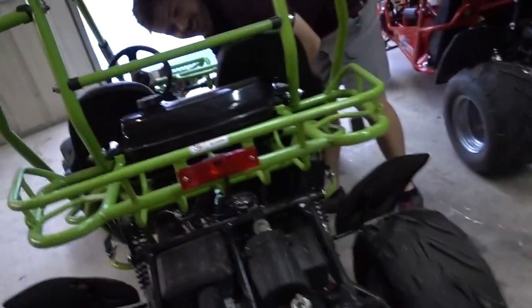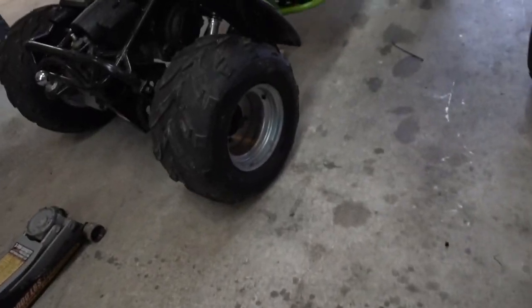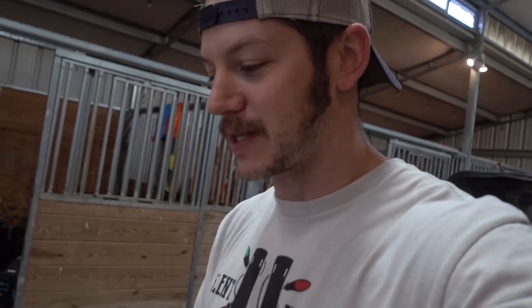Morning danger, Dave. Hey, dude. Morning, everyone! So, we were running that tire a little low, and then it came off, and I had never remounted a tire like that. These things don't have tubes in them, so you need some kind of pressure to get it to hook, to seal to the rim. So we just sprayed a bunch of stuff in there and lit it. We made an explosion inside the tire that pushed out the tire, sealed against the rim, and then we hooked up the air tank to fill it up the rest of the way. Super cool! Science, very neat.